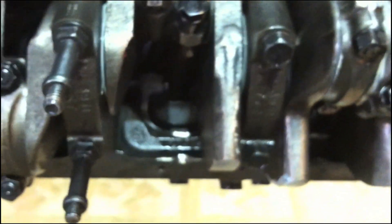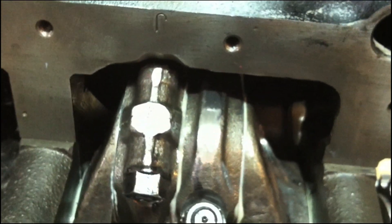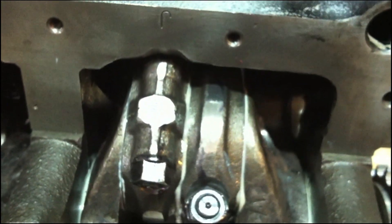As you can see on our Chevrolet small block engine, with a stroker crank making it a 383, with a longer stroke which moves the rods down farther and the pistons down farther in the cylinder, upping the compression. We have taken a die grinder and clearanced our block to make room for the rod throws. As you can see, we've got a lot more clearance here now - making it safer, no worries of anything cracking, breaking, getting caught in there, or screwing anything up.